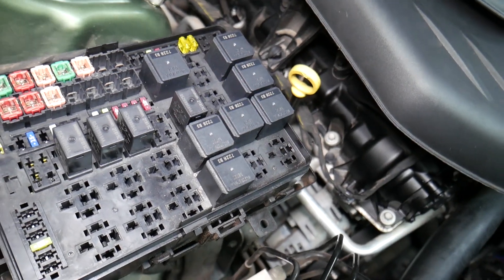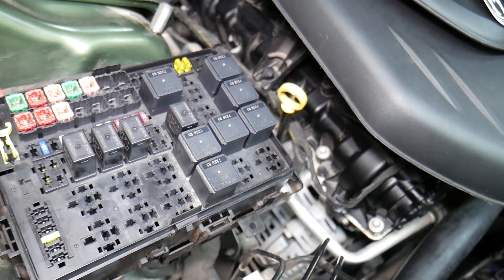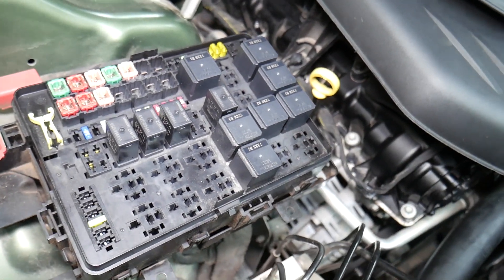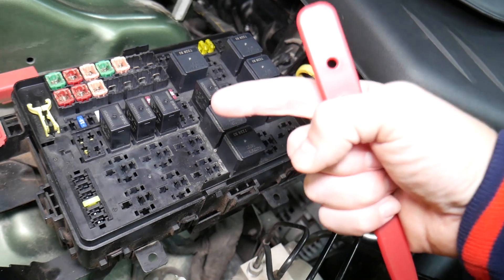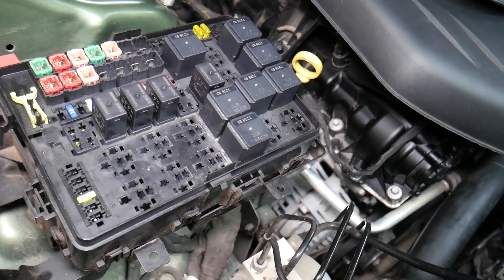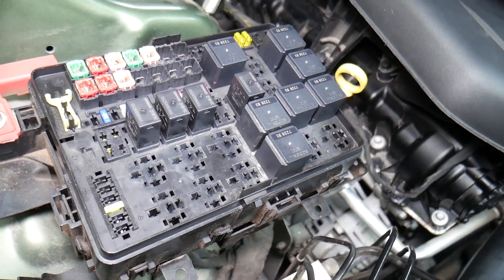For some fuses it's important to disconnect the car battery before removing them, otherwise you can burn the electronics. When working on airbag fuses, you need to wait at least one hour after disconnecting the battery. If you're not qualified and certified to work on the airbag system, I would never recommend doing that. Also, a common mistake people make is not knowing which battery terminal to disconnect and reconnect first — if done the wrong way, you can burn electronics modules. We know because we burned a traction control module on a BMW that cost $2,000. We'll put a link in the description on which battery terminal to disconnect first.